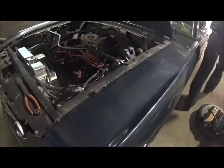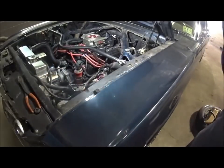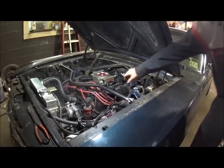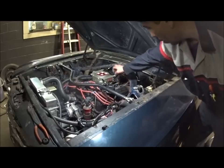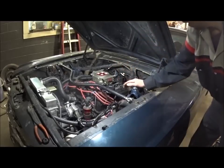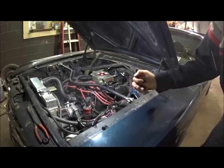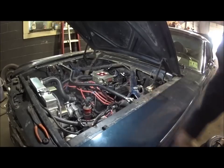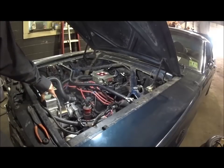Going to the front — as you can see here, throttle body assembly with four injectors inside. There are the lines coming up to the front — your pressure and your return line, also quick connects. This connection here is to hook up the handheld unit to monitor data stream, data log, or change settings in the fuel control.